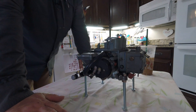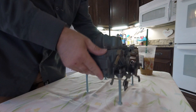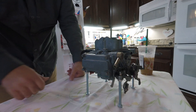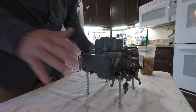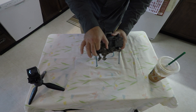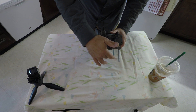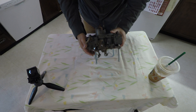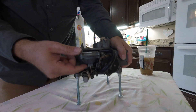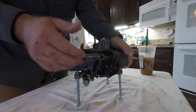Alright, so the next thing is to essentially take everything apart. And again, there are a few lessons that I've learned along the way — mostly to pay attention to where stuff is attached. You'll see there's a mark there — that's where the throttle came and attached, and then the return spring was here. The first time I took it apart, it was because this over here was leaking.